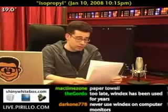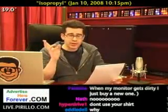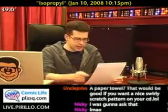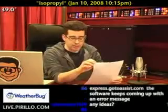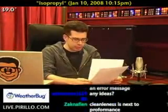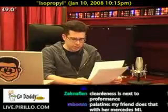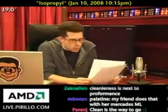Number 3. Cleaning computer mouse and keyboards. Using a paper towel or cloth, spray a little onto the cloth and apply to a dirty mouse and magic, clean. Repeat for your keyboard. Try using compressed air spray on and under your keys if it's particularly dirty before cleaning. Remember to test on a small area, as some plastics can get gummy from isopropyl alcohol. If in doubt, do not use. If quite sure, but not certain, dilute with distilled water.